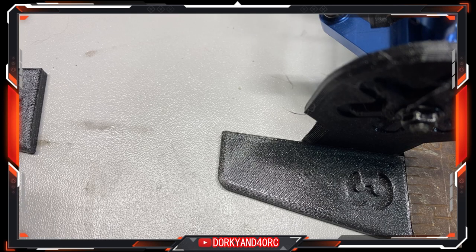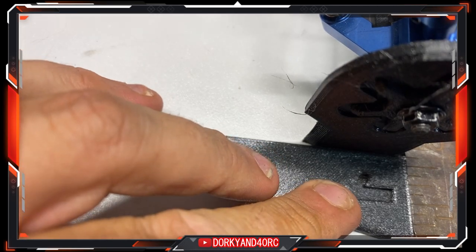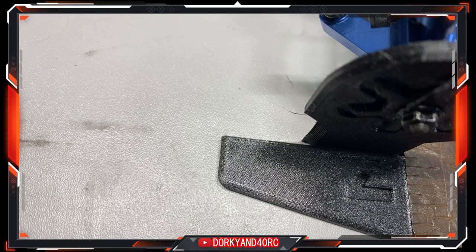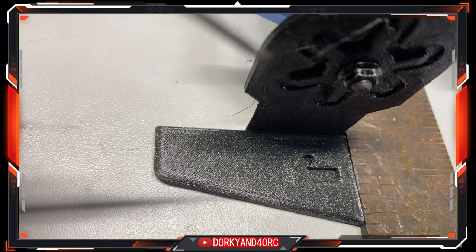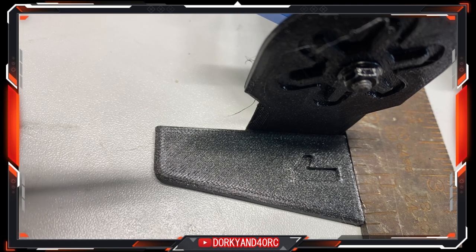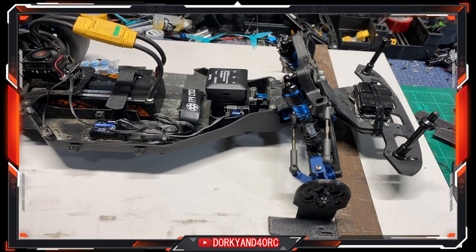You can really see how minute this is. If I put it into three degrees, I was really running at about three degrees toe out, which is a lot. So we're going to throw that back in there and close up that gap a little bit with our turnbuckle wrench. Now you can see that gap is completely gone — we are at one degree and good to go, completely square. And now we're going to do the other side. That side was bang on, so we're in good shape now. Go ahead and just turn everything off and we're ready to put the car back together and go run it.